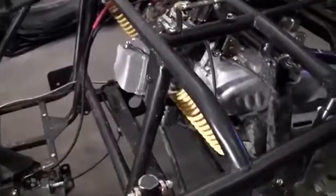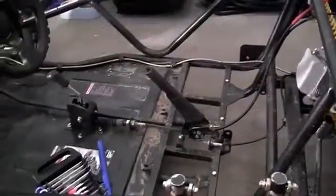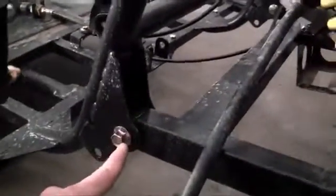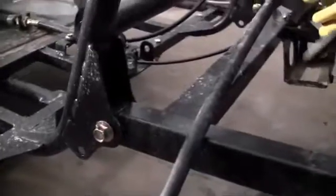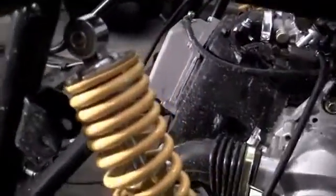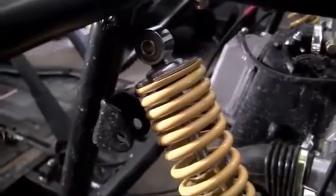Thankfully, this go-kart frame was built where the roll bar and 1 hinge is supporting the back connected to the front. Now obviously, as you can see, this go-kart does not have a roll bar on it, which means that the only thing connecting the back to the front is this hinge right here. If you can see over here and on that side too, there's a hinge system. So therefore, I believe that if we jack up right here, then what it's going to do is it's going to allow this back end to pivot and drop down, therefore making sure that the strut lines up perfectly with the bracket. So again, the mechanics can keep their fancy tools, but what I'm going to do is just jack up the middle until the top of the strut fits in the bracket.